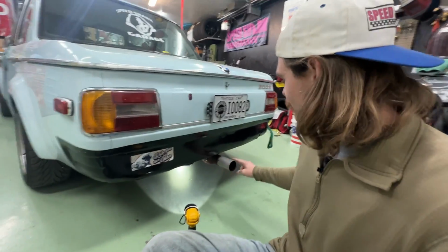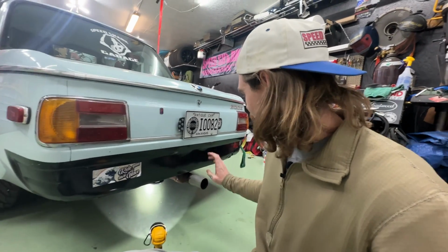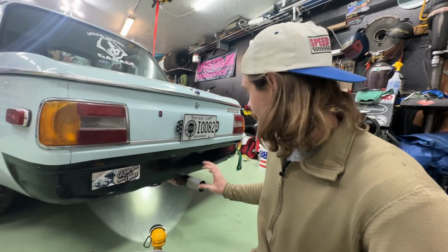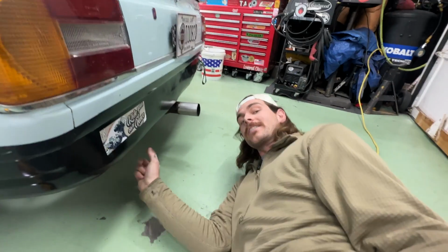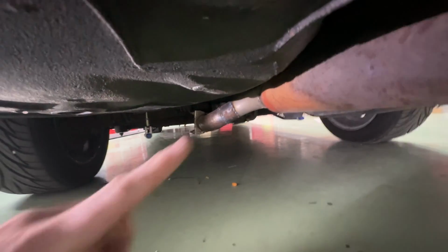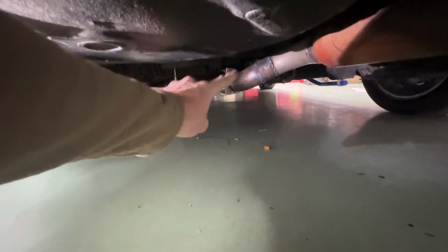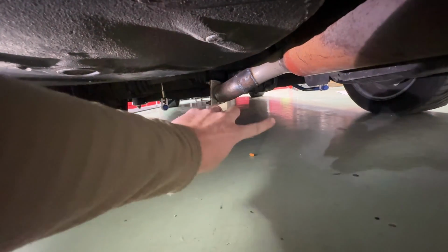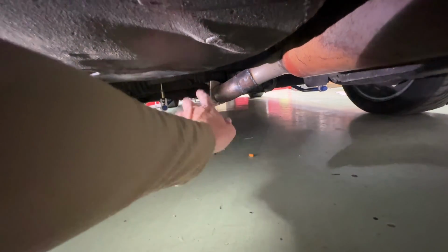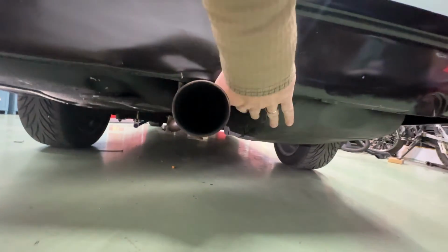This pro tip here of just an exhaust pipe that I just wanted to come out past the bumper is ugly. Don't like it. I'm going to try to figure something out. So underneath is our cherry bomb and some okay welding because, like I said, just wanted to get it on. There's the cherry bomb here, runs down, does a 90 to another 90, and there's a clamp. I purposely did that. That way I can unclamp this very easily. We're going to chop it, keep this bend, maybe clean up some of those ugly welds, and then be able to clamp our Borla. A good amount of space on this side and this side.